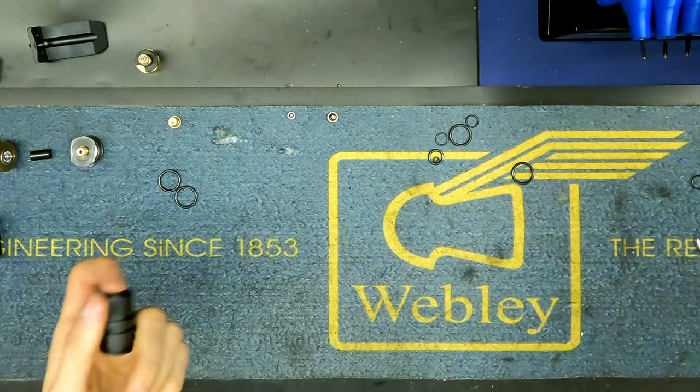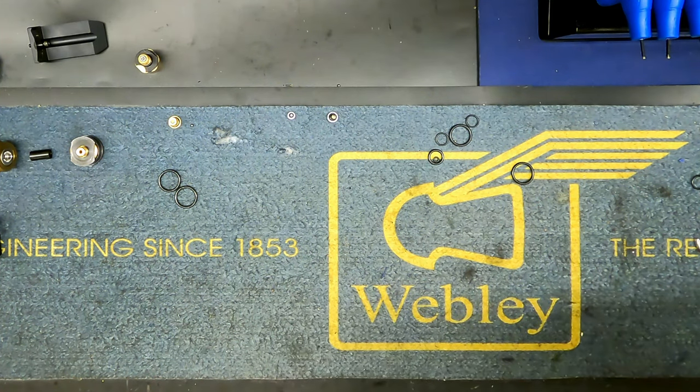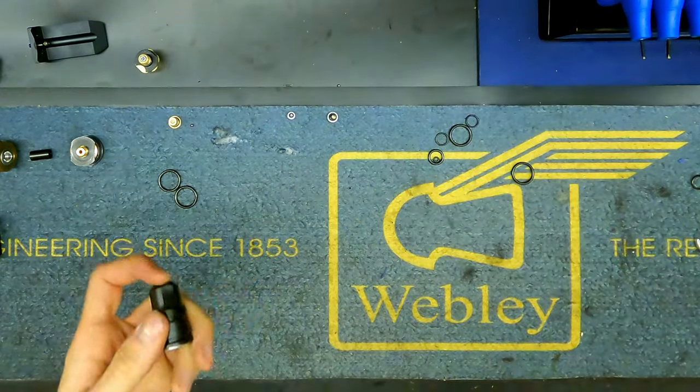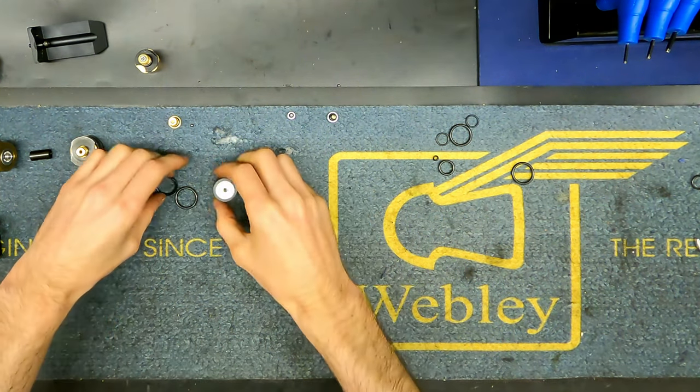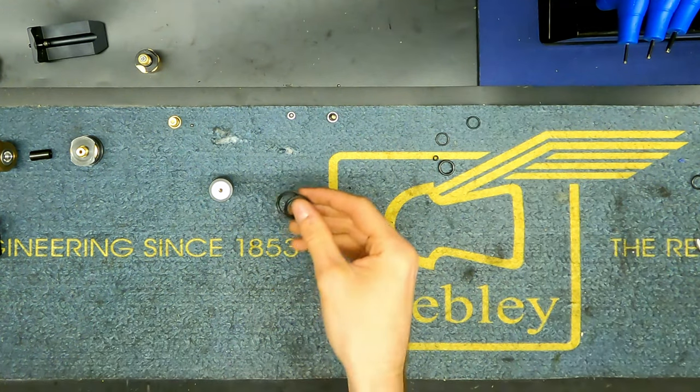Which is exactly where I've returned it to there. I'm just going to double check on the calipers as well. It was just a smidgen over 38, which is where we are here as well, so exactly the same. So then we've got left on the rig just to replace these two outer rings with the new ones.